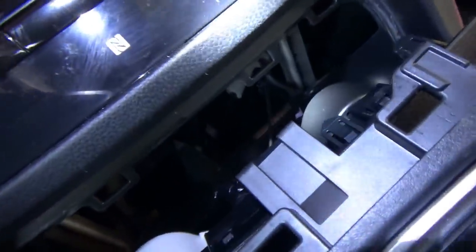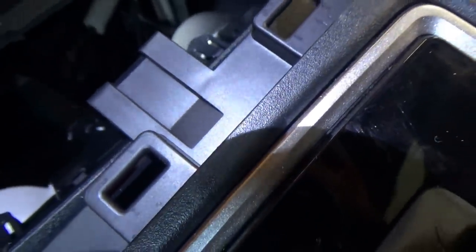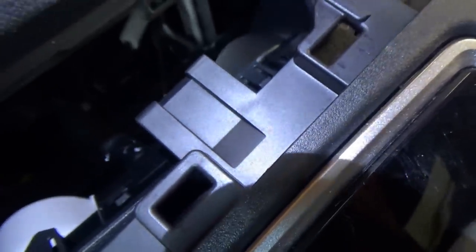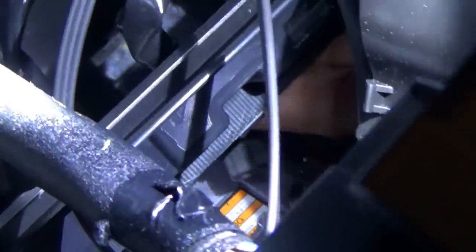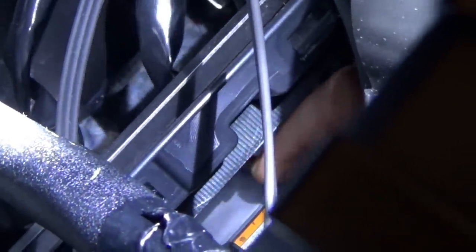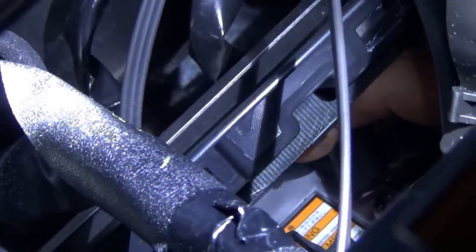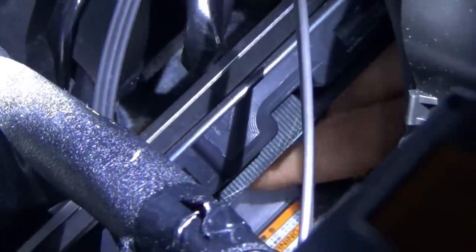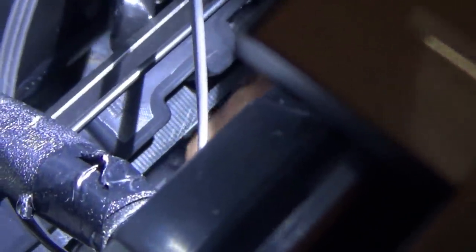With the heater panel off, we can actually get to the connector. It was plugged in like this: the ground was going to the power pin, and the power pin wasn't attached to anything at all. They just plugged it in wrong. It's supposed to be foolproof — hard to see how you can mess this up. It's supposed to be plugged in so both pins make contact. What a novel concept — we actually need power and ground for something to work.